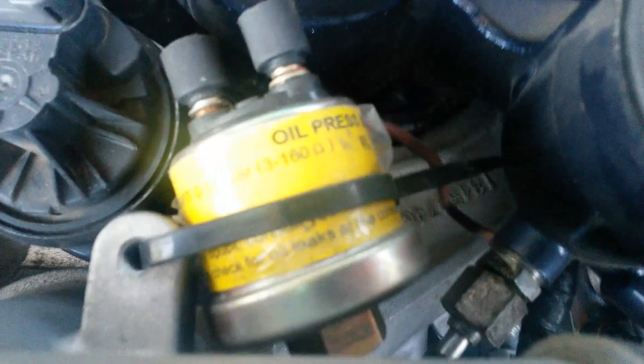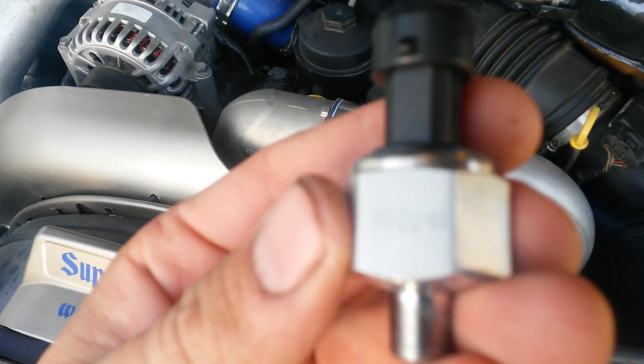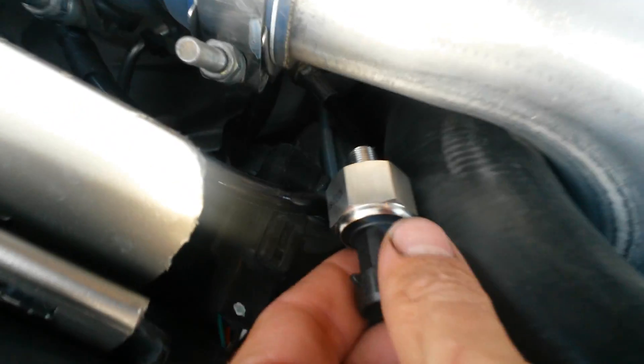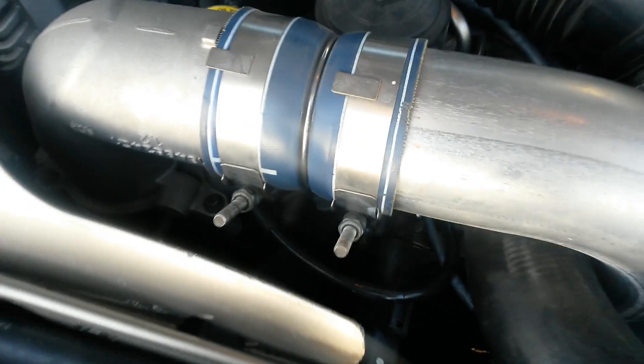Then you're just going to get yourself a really inexpensive eBay gauge and pressure transducer. This here is the resistance type of pressure transducer — it outputs in ohms, 3 to 160 ohms for the output. So it's basically inputting 12 volts and outputting variable resistance. The better style is one of these 5-volt pressure transducers, which I'm actually upgrading to. That's just going to screw right in there in place of my grease gun whip and 12-volt sensor.